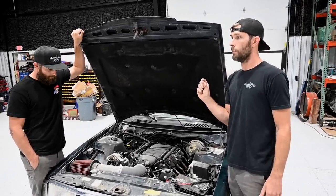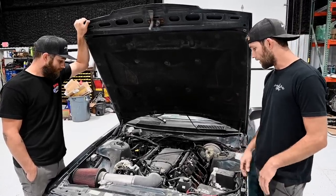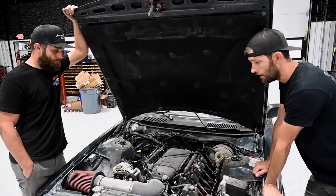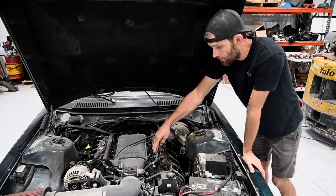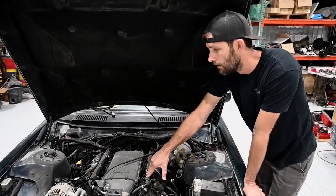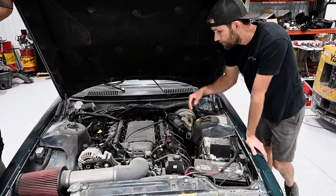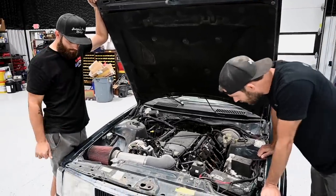It might rub the pan a little bit, but it also has a Holley pan on it. We ended up with quite a few different pieces to make this thing work. It's got Holley's hooker cast manifolds — they have like half-inch thick flanges, they're awesome. Steven used them on his '64 C10. They're good for swaps, they fit the block tight, and they really look good. It's also got Excel injectors, I think they're 80 pound an hour. We went with big injectors because the guys at Holley said if you want to turbo, supercharge, or spray nitrous on it, you need more injector than you need — and that made perfect sense. So they hooked it up and sent a set.